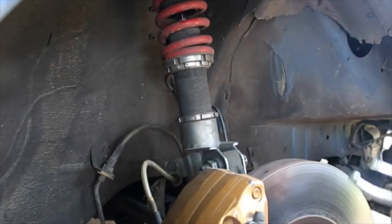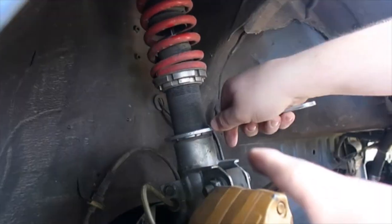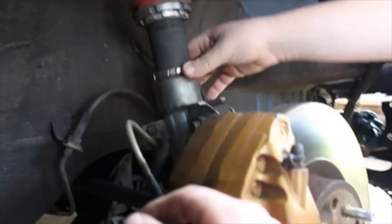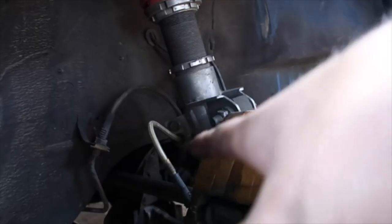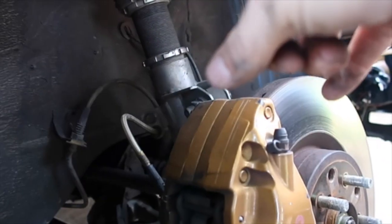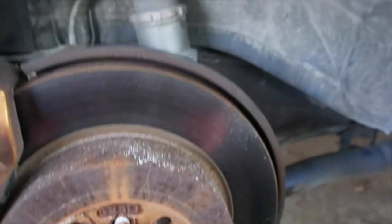So since the spring rate is messed up - we're not adjusting the spring rate on this one because I've already done it previously - I'll show you how to do it on the rear. We're going to go ahead and lower the coilover just a little bit, make it flush with the bottom, all the way around. The height should be the same all the way around and then we'll adjust the spring rate and it should be okay. While he's doing that I'm going to work on taking this little bastard off. I'll take the brembo off first.